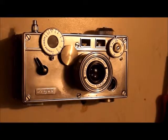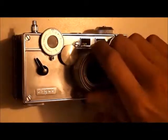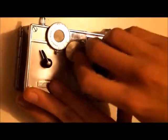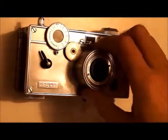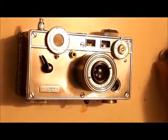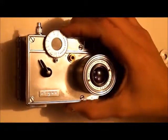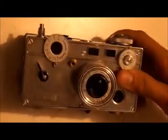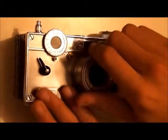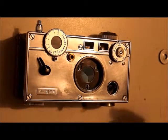To open up the front of the camera and remove the front to get into all the internals, you're first going to want to set your lens to the three foot mark on the rangefinder. That's because the lens is extended to its furthest position and the cap can easily screw off. Then once you take the cap off, leave that aside, and then pull out the idler gear. Now it is important you do not start turning the rangefinder willy-nilly, because if you go past the three foot mark to the left or past the infinity mark to the right, you're going to go into a section which damages the rangefinder — meaning you're going to have to calibrate it, and it is not fun. Then you're going to take the lens, twist it counterclockwise, and set the lens aside. Now do not touch the leaf shutter, because then you're going to get oil all over that, and that also won't work.